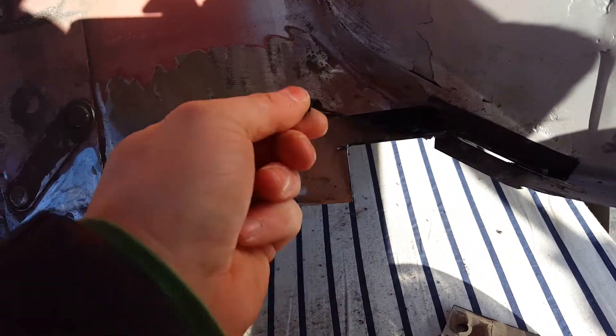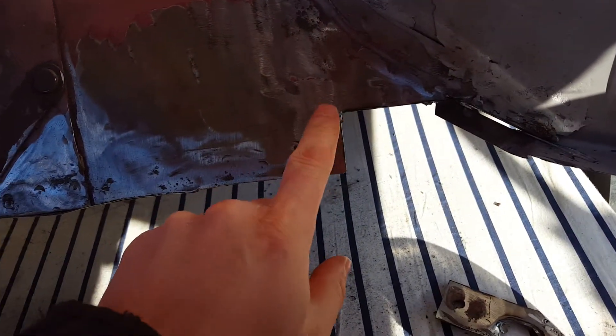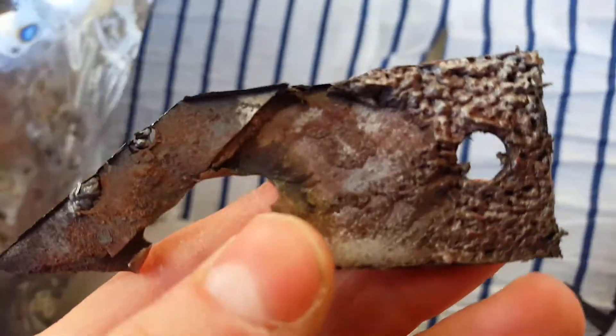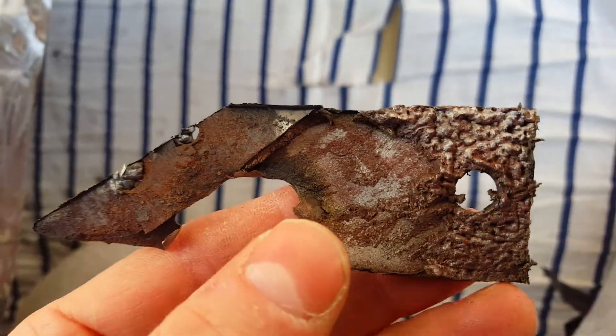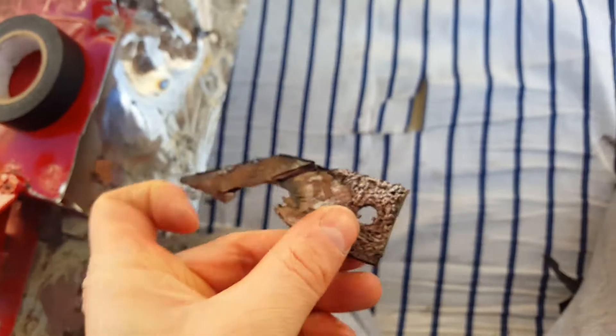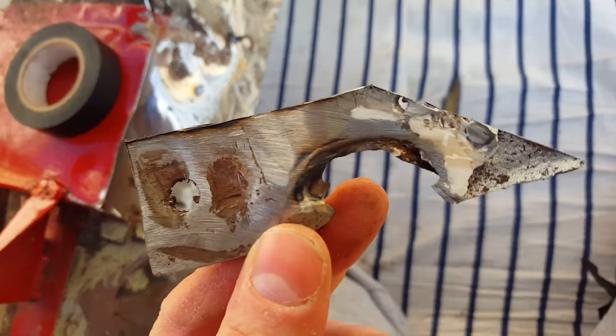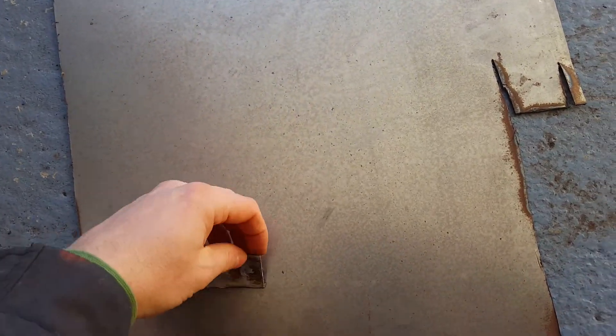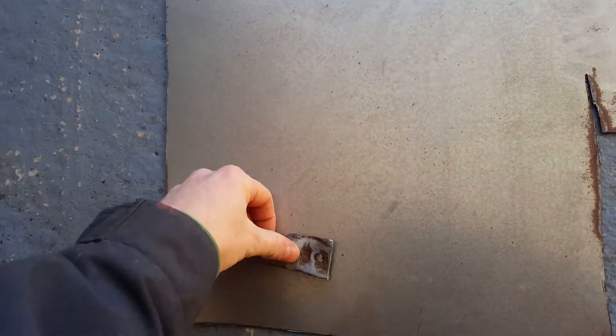So that bit's cut out — quite a neat cut. You can see where it had been filled with body filler previously. The good thing is the bit that's come off — you can see it's pretty nasty underneath, a lot of sealer but obviously rust underneath. So what I'll do is use this as my template, put it straight onto some new steel and see how that fits. This is just a bit of sheet steel — quite a large bit for £20 and it'll come in handy for restorations, saving quite a bit of money for simple pieces like this.